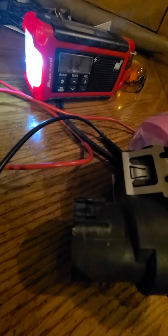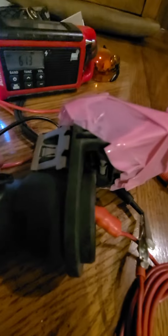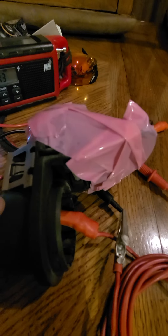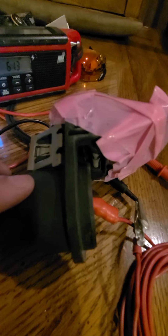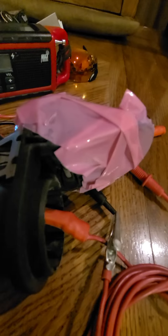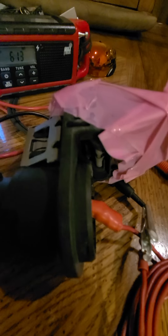I brought it in to test it. I'm just checking continuity from the front side of this to the back side, to the corresponding pins. The left and right brake lights are showing a resistance of 7.1, the positive is at 1.2 something, and the negative was all over the place — it just keeps bouncing around.